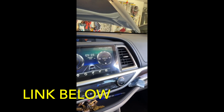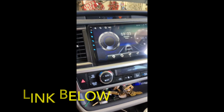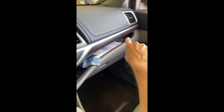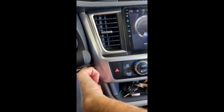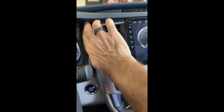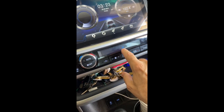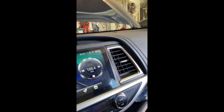On a 2016 Toyota Highlander, putting in the VB Tech radio is pretty easy. There are some parts that need to be removed and I'll go over them in the order they need to be removed. First, this piece comes out — pull it out here and get something behind there like a plastic spudger. I'm not going to do it because I've already installed the radio. This piece will come out; carefully pull it away at the end.